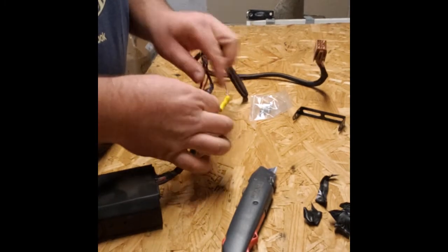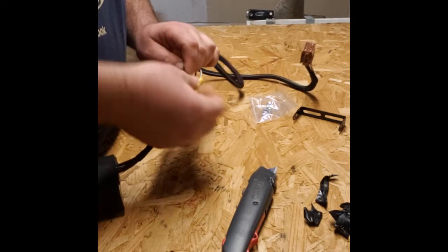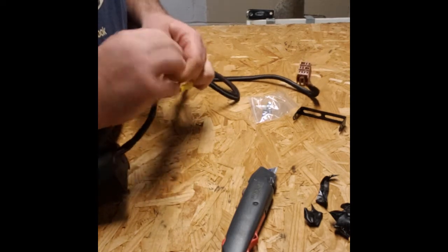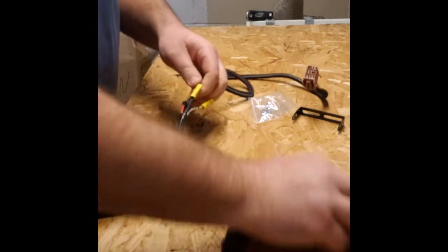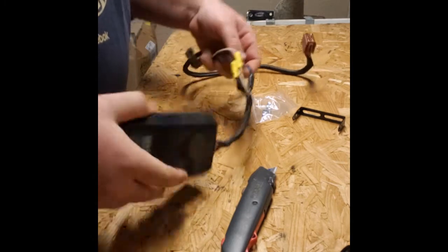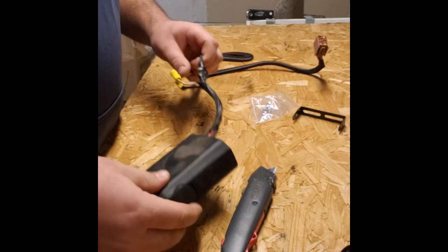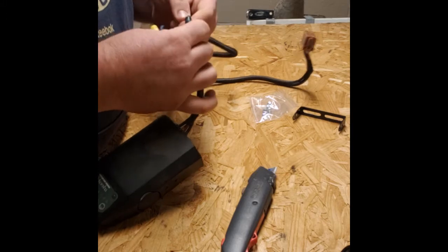These are colored. There are blue, yellow, red, and each one of those colors correlates with the size of wire that is used. So if you're not using the correct connector for the correct wire, you can also have some connectivity issues there. And I think that's probably part of the issue with this one. And it's pretty old. It's 11 of 02, so it's a 2002 brake controller on a 2004 pickup truck. So who knows what he came up with for that.